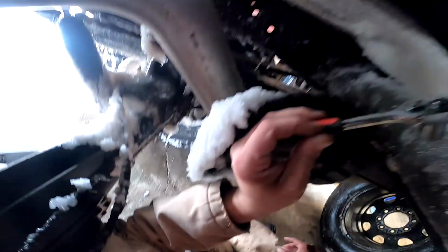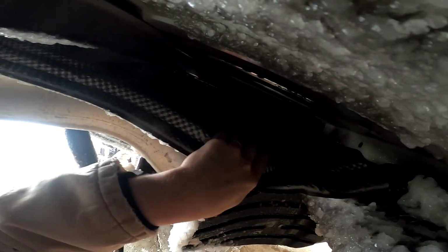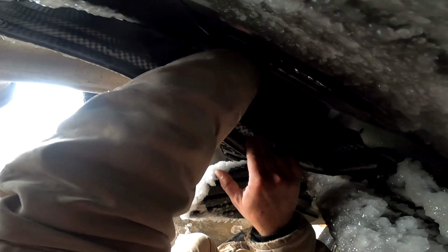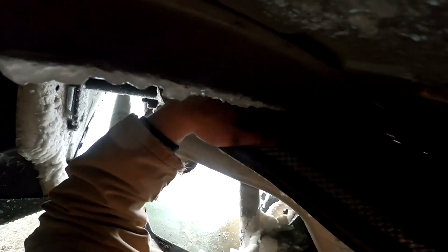All right, one bolt down. Save this in your keeps pile, I guess, if you've got one. Here's mine. All right, there is a flange of some sort. There's that other one I saw in the picture. I recommend using a box end wrench to remove this one. Otherwise, you too will have problems. There's not enough room for the ratchet to get it out of there. We should have at least one more. It's up front right there. I could be wrong. I'm most definitely wrong.